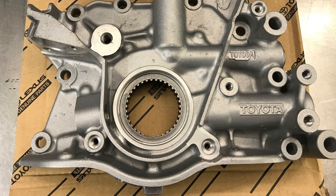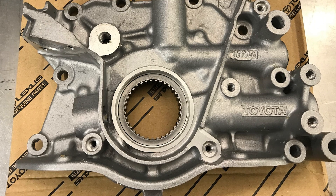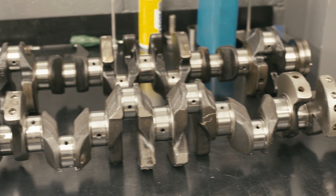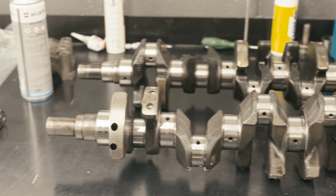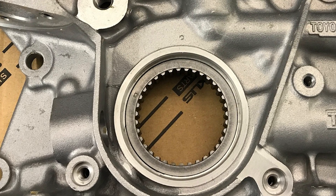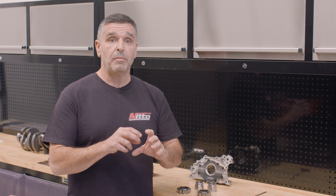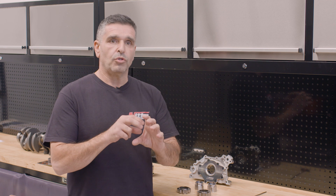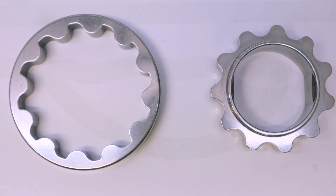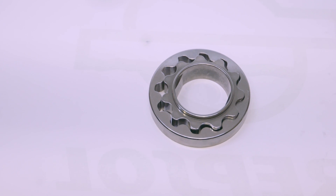Originally we looked at what the Toyota 2J has, and that was a spline drive. The problem we found with that — and it's not specific to the whole range, but in some of the OEM crankshafts especially — is that, say for example an RB30, it revs up to a certain RPM and then all of a sudden it turns and does weird stuff in terms of harmonics. What that does is basically affect how the drive is to the oil pump. Having a spline drive in our opinion would mean that with that little bit of extra flex that an OEM RB30 crankshaft will have, it will cause binding in our oil pump design. We felt that was not the way we wanted to go, because we wanted to design an oil pump which would be able to fit in every RB, the same as our original oil pump.